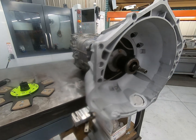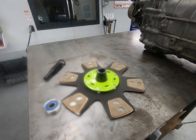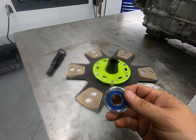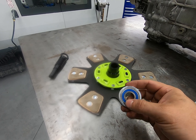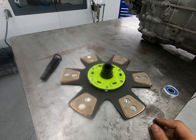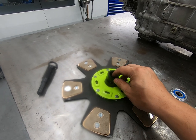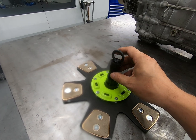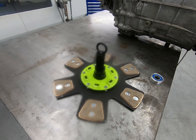Alright, so there it is. Our transmission is now ready to be installed to our Gen 3 or Gen 4 LS engine. The only thing we have left to do before we put the transmission on the engine is to install the clutch. The kit does include this pilot bearing with pilot bearing adapter. This will go on the end of the crank into the large bore diameter that's in the end of the crank. Typically an LS7 bearing would go in that bore, but for this application due to the shaft size, it requires this bearing with this bearing adapter. The clutch disc has an extended snout on the hub that is going to be facing out away from the engine towards the transmission. It also comes with the alignment tool — make sure the alignment tool is free to slide in and out before you tighten down the pressure plate fully. Always make sure that your flywheel and pressure plate are free of any oil or debris.